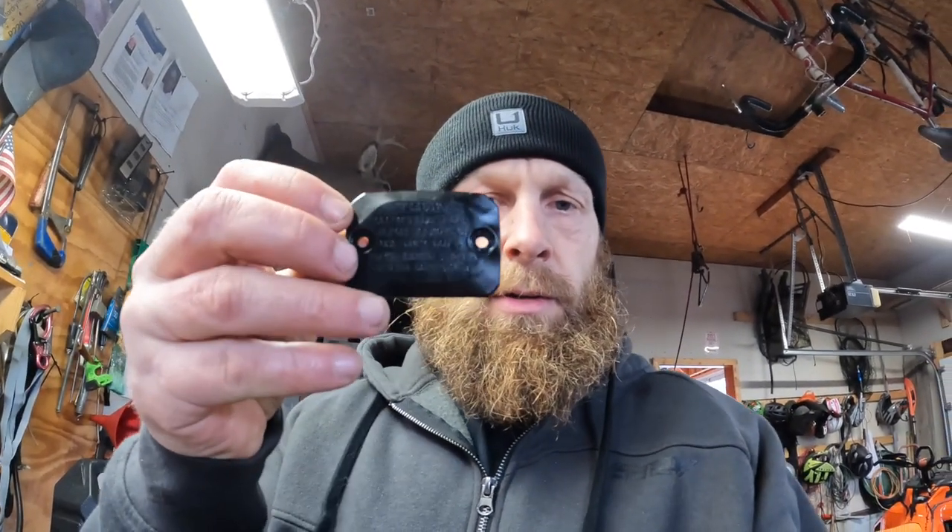Hey guys, I want to give you a little insight on the brake fluid we're using for this brake reservoir replacement. I got a little excited and ran down to the local parts store - I said I'm flushing out my brake fluid on my snowmobile, what do you recommend? They gave me some DOT 5. When I got home I happened to look at the top of the reservoir and it says it recommends DOT 4. I started doing some research and found that DOT 5 is a different makeup with different chemicals than DOT 3 and 4.